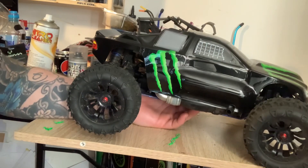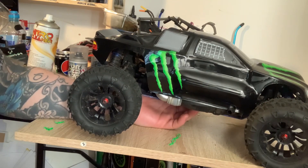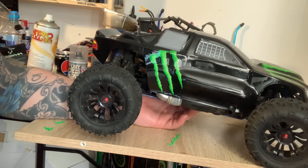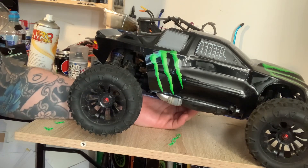Obviously when it does start, it is a very good running engine. Follow the break-in procedure and then you can tune it up. Just keep an eye on temperature. Listen out for the sound — if it sounds good, it's not bogging or anything like that. And just make sure that you have a thin, visible blue line of smoke coming from the exhaust at all times.